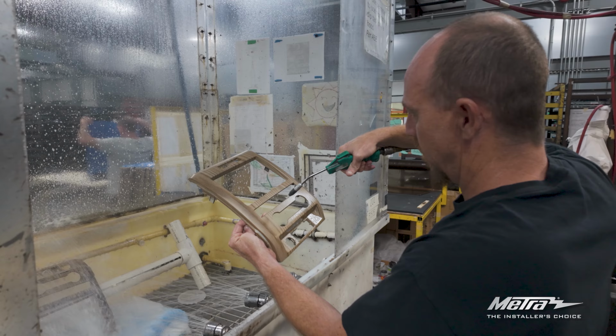Then remove the exposed two 9/32" screws. Next, using a pry tool, unclip the two AC vent panels to the left and the right of the climate radio panel. Then unclip, unplug, and remove the climate radio panel.